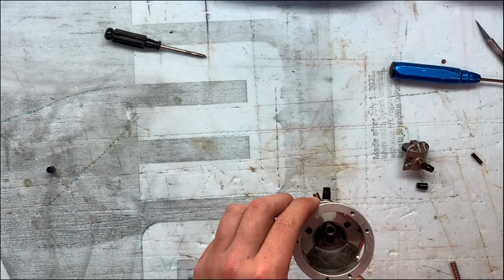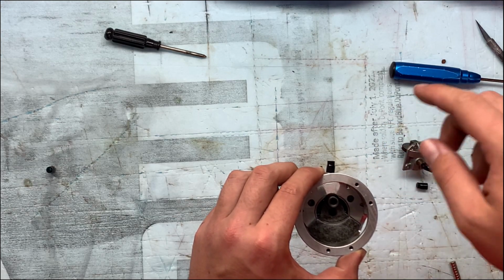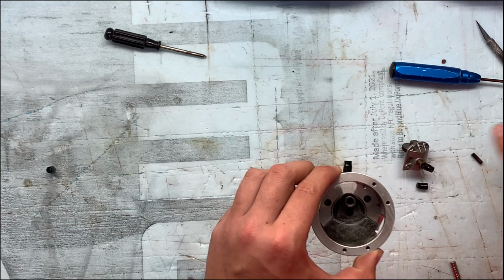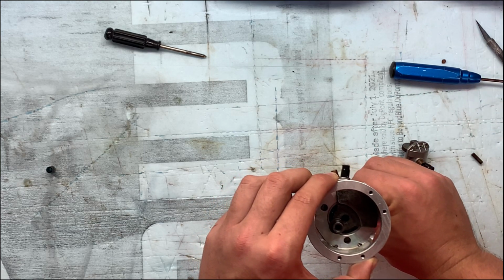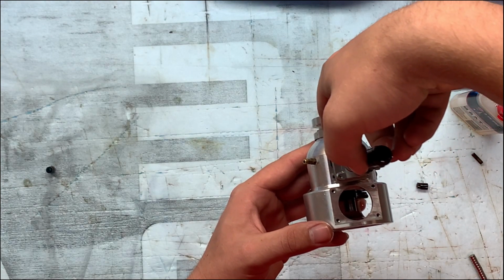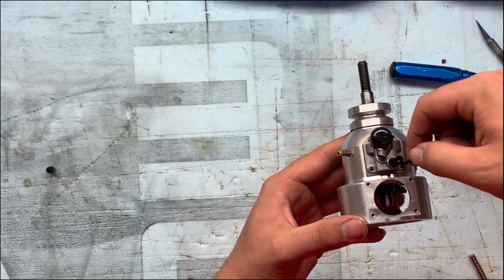Now we're going to go to number 3, and there's a lot of people who think that to time number 3 correctly you have to go 1 revolution around, but you actually do not want to do that because of the way the cam gear is designed. You only need to spin it to cylinder number 3 one time, like this. I won't tighten them down very tight, in case I mess up. Sorry if my head was in the way. But in case the timing is off 1 tooth, I don't have to remove all 4 screws.